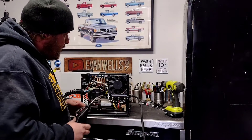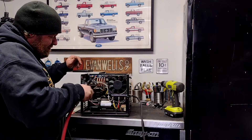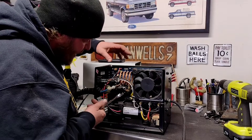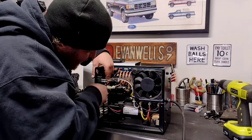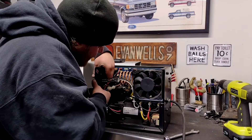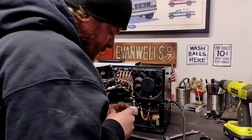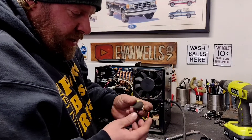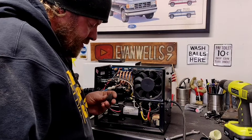Just got the shop air hooked up and blowing this thing out — nothing too crazy. Next thing I'm going to do is take the air filter out and check it. On my particular model a 5/8 wrench gets this thing loosened up — it's just a little plastic housing, so nothing too terrible; you don't want to over-tighten them. There we go — just a little tiny felt filter and also a little piece of foam. It doesn't look too terribly dirty but I'm still going to blow it out anyway and go back together with it.